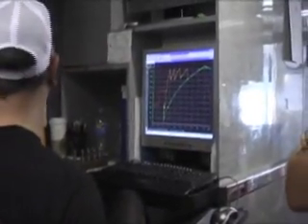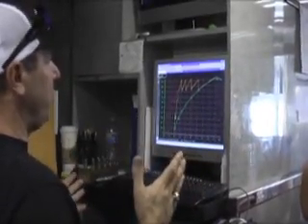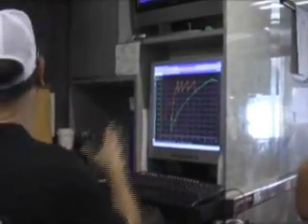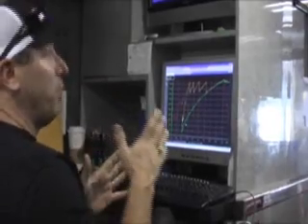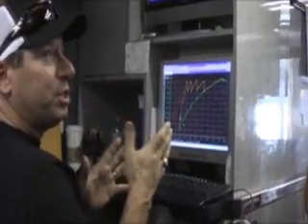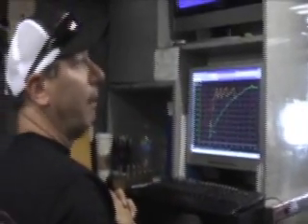When you gear it too aggressively — too far away from zero — like a three-to-one first gear, that's an exaggeration, but it's going to spin the tire really hard. If you put a two-to-one first gear in, you'd have three of those dips just trying to get off the start. So you try to get in between those two. Our margin of error is a 2.60 first gear, then we run a 2.62 first gear — two points — which is about one percent. On that run, we probably needed two points more first gear to make a better run, which is one percent.